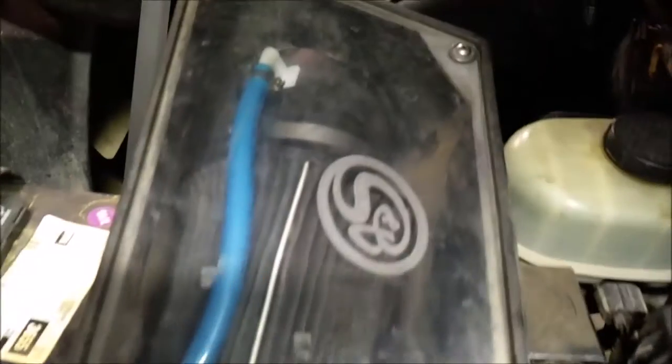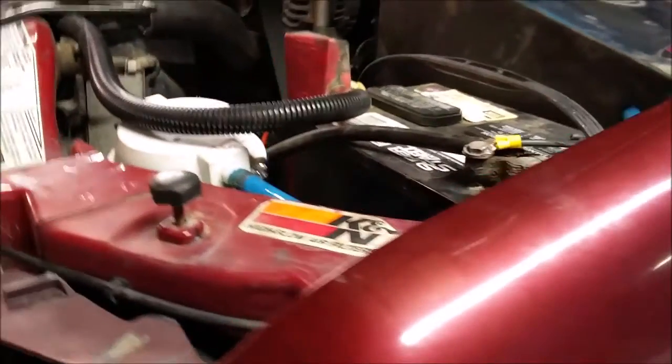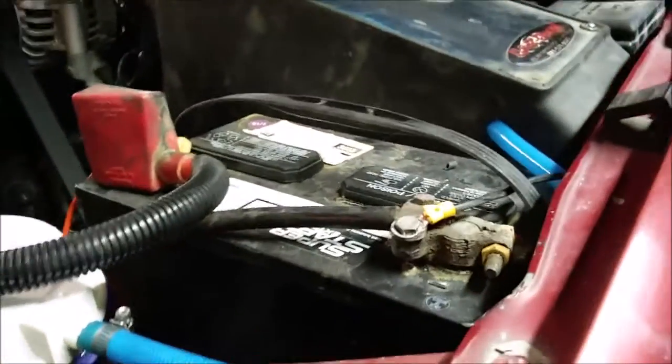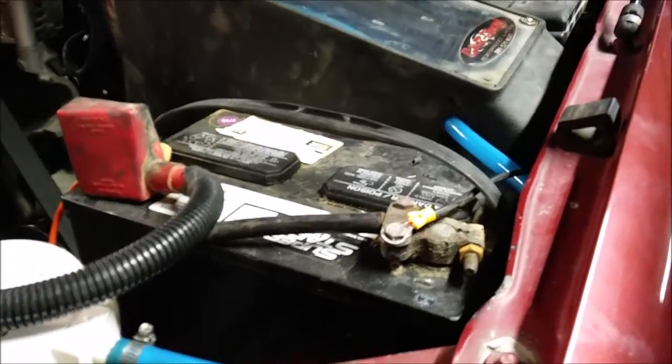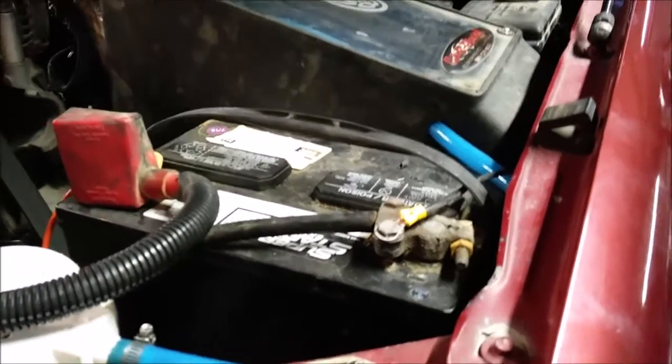From the filter, you go into the air intake just after the air filter and before the turbo. This customer has our 820 kit that includes the PWM, so we will be switching the PWM instead of the power through the relay. We have power coming from the battery to an automatic resettable circuit breaker, and from there it goes down to the cell.